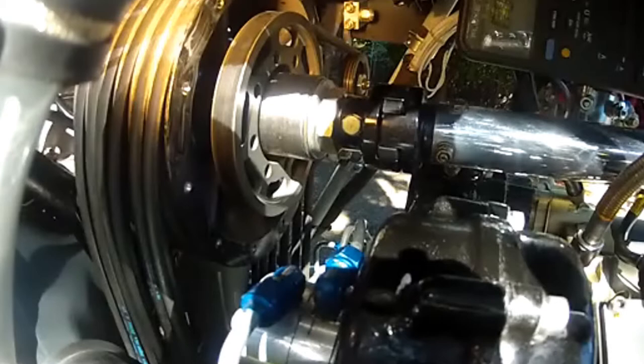The other point I want to make is that I had no rotors on the main rotor shaft. I'm running this in my driveway, so that means there's no load on the transmission and I can get that transmission spun up very quickly. In practice with the rotor blades attached, you're going to have a lot of drag and a lot of inertia, so the portion of the clutch engagement where this problem occurs is going to take you longer to get through. You can't just run the clutch into the engaged position quickly because you'd over-stress the transmission because of all that inertia and drag from the rotor. So the part where these belts are going to be galloping around — it's going to take longer to get through that.